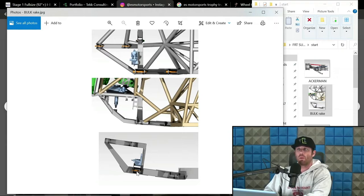A high probability. And I would do it where I would gain between 2 and 3.5 degrees at compression. Just to give you some generalities, I do like the way that feels. I feel like there's some good characteristics both on the braking or decreasing side of speed, as well as some mitigation through some of the rough stuff as well. So that's my flavor, so to speak.